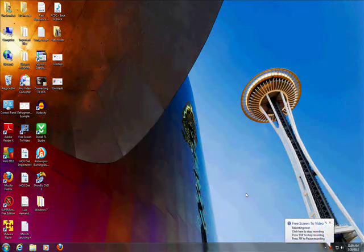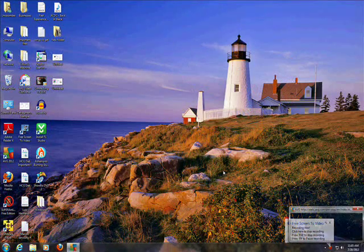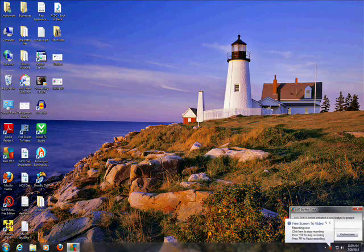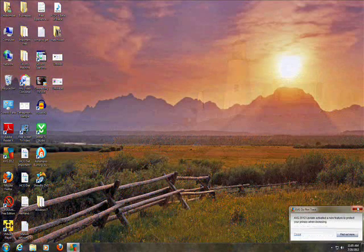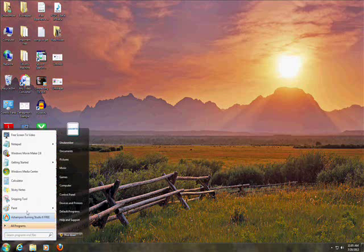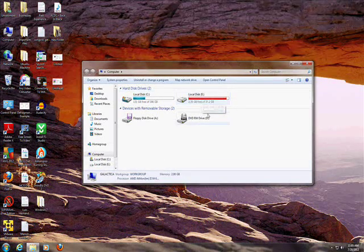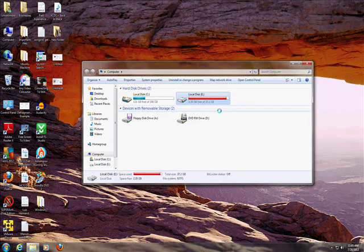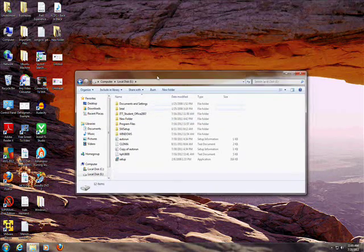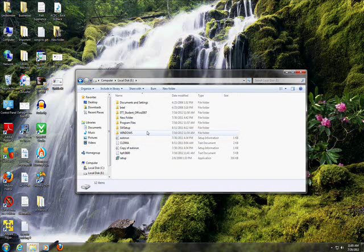Now that we've got our regular hard drive turned into an external hard drive and connected to our computer, we're going to retrieve some files. It just recognized it — that's what that sound was. Let's go to Start, My Computer. We should be able to see it in there, and there it is — Local Disk E. Let's open it up. This is Windows XP in here, and I'm going to try to get some stuff from the desktop.